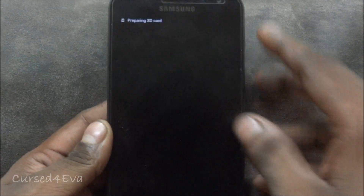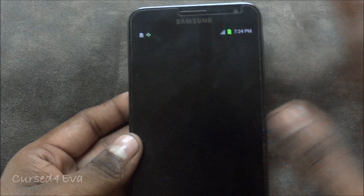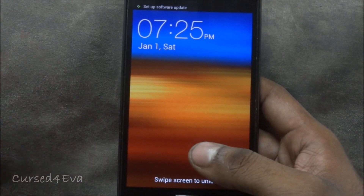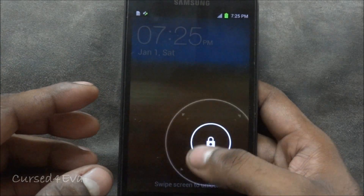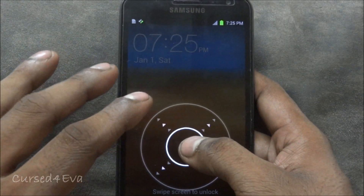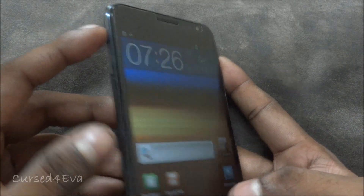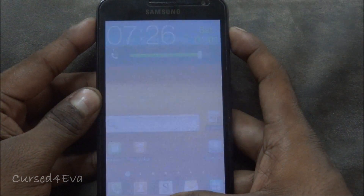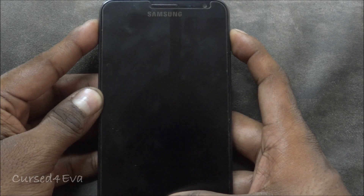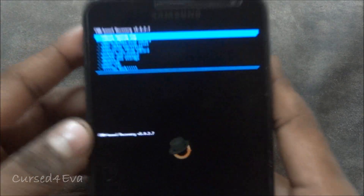Okay, the first time the phone is up all you're going to see is the notification bar — you're not going to see anything else, and tapping the buttons won't give you anything. Don't worry about it, that's how it's supposed to be. Long press the Power button and reboot. Once you reboot you get back to the screen with ICS loaded. Then again Volume Up, Power, and Home — hold all three. You may take a screenshot, don't worry about it, keep holding till the phone reboots. Once you see 'Samsung Galaxy Note' on screen, let go.